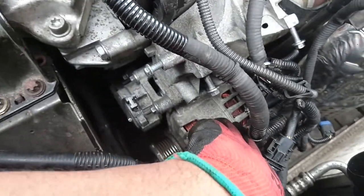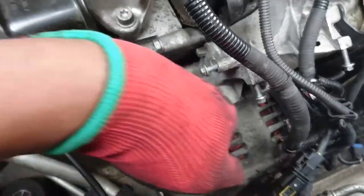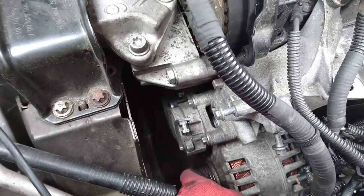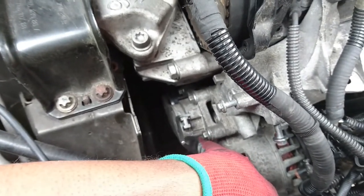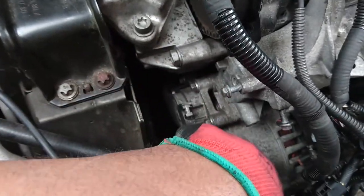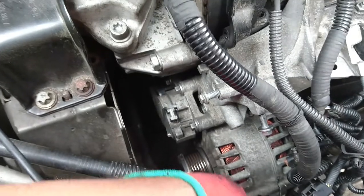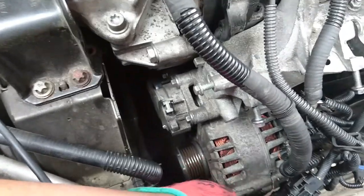At the start of this video I'll write in red letters: disconnect the battery. Also, when you take out the belt here, make sure your finger doesn't get in between the belt and the pulley. Because this is spring loaded - if the tool you're using to pull the tensioner down slips, your finger will be between that and the belt and the pain is excruciating.